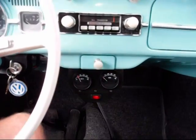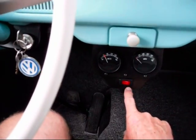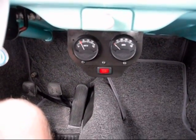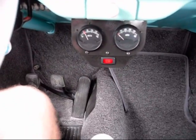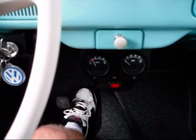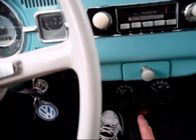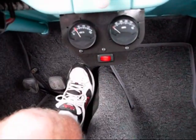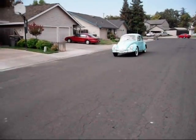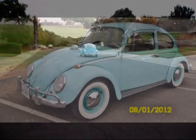I talked about reverse. On the controller is a half speed reverse mechanism. So what I do is use this toggle switch here — you flick it over, and a light comes on to let you know that it's half speed. When you put it in reverse, you don't have the car rocketing back. We put it in reverse and go back at half speed, which is much safer because of the low gearing and the immediate power you have to the motor. Then flick it back and put it back in first gear.